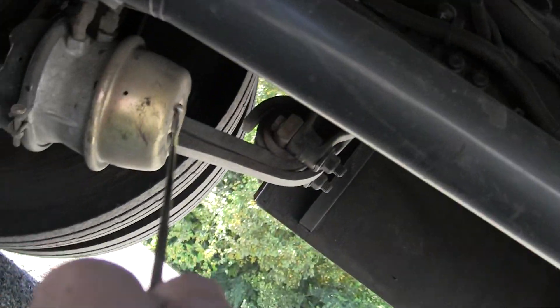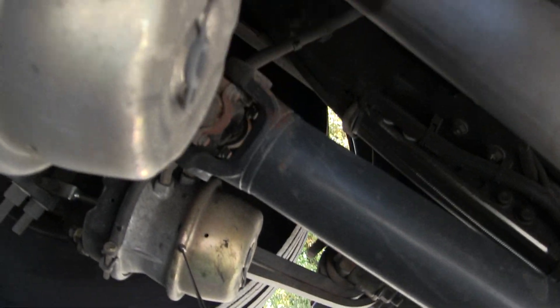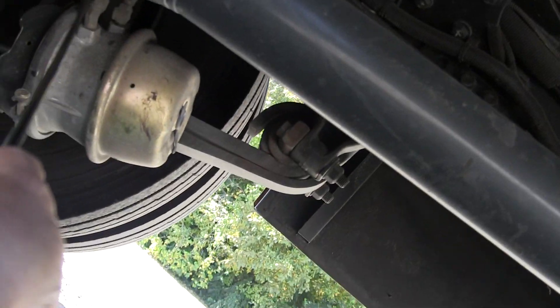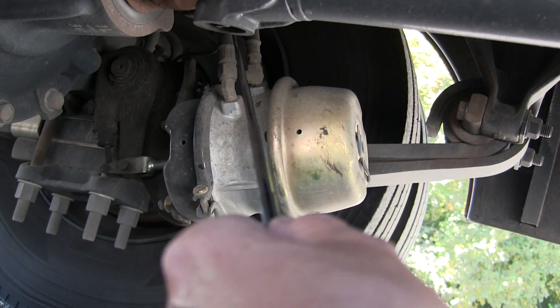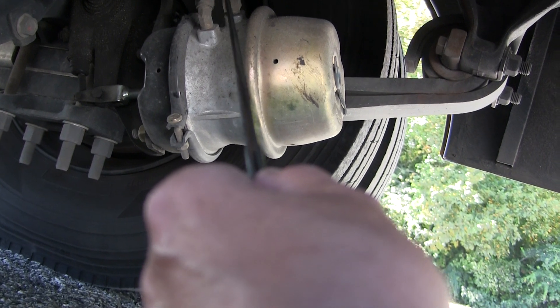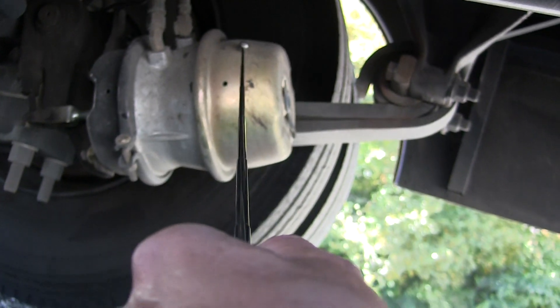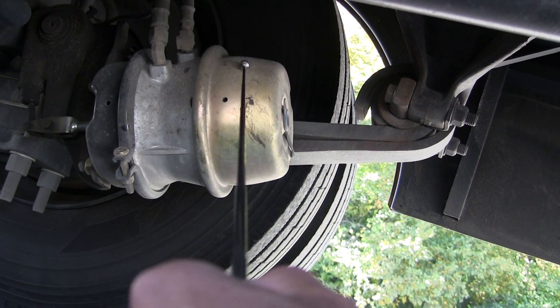If I get all the way over here, this is our brake chamber. We have two of them — one on this side and one really close to me. And then we have our brake hoses, which are right here above the brake chamber. Those are brake hoses right there — they're not cracked, security mounted, not leaking. This is our brake chamber — it's not cracked, security mounted, not leaking.